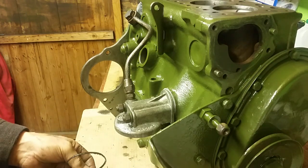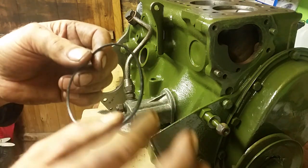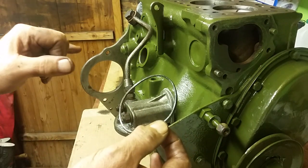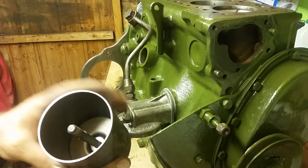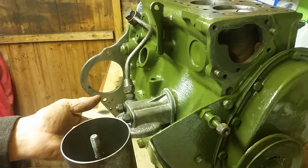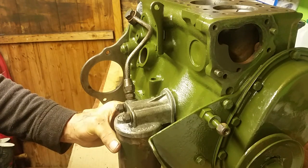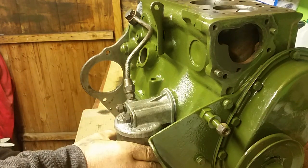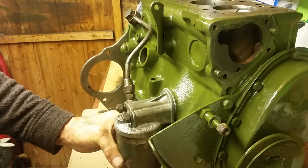Remember: our next job - this is a must - you must put the rubber seal into its recess in the housing. You can't see it because it's upside down, but there's a recess specifically for it and you'll see it clearly when stripped down. You must take the old seal out first - don't put the new one on top of the old one. The final job: with the wire retainer and new element in place and the new seal seated in the housing, slide the housing underneath and tighten it up - righty tighty.